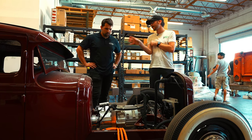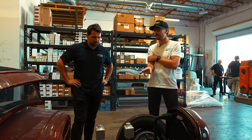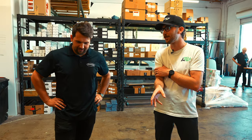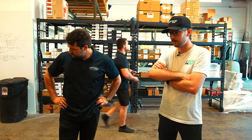So the Cascadia IM-225 — even though that's not technically the title — means it's got 225 kilowatts of power. This one, after the three-to-one gear reducer, puts out about 1,100 foot-pounds of torque. That's a lot for a very light vehicle. And it is rear-wheel drive, so it goes straight to the stock rear end.